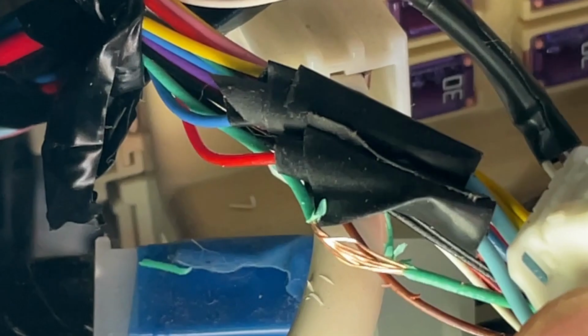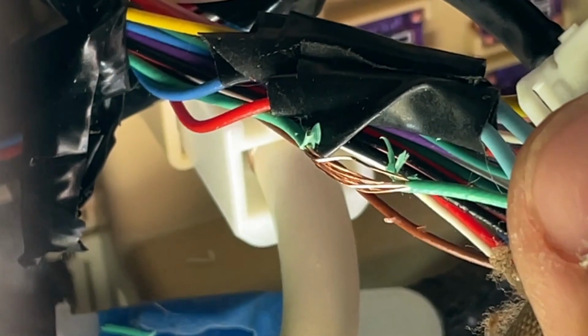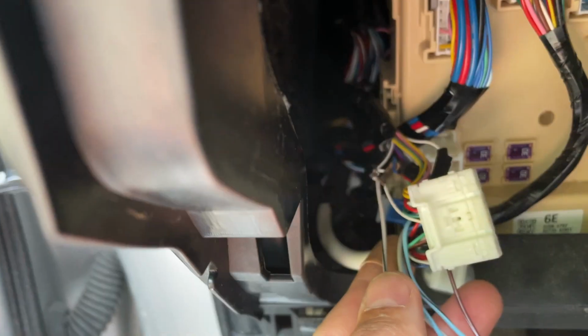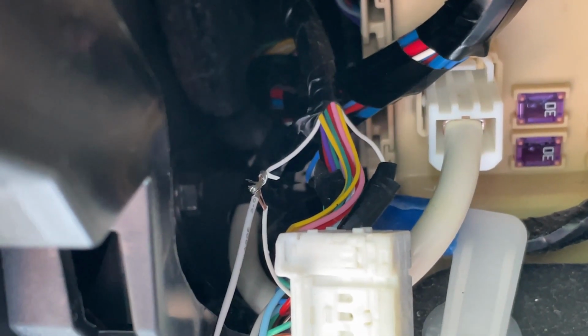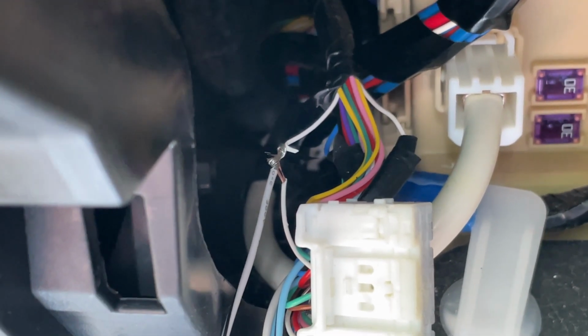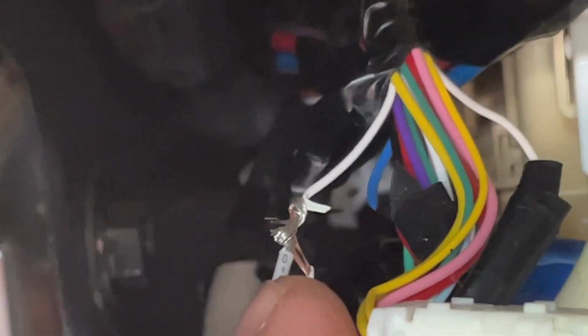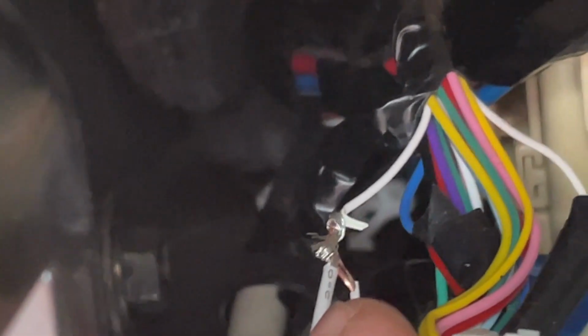All right, there's a wire I've got split open. I'm gonna thread a new wire through. All right, this is a real study in patience, I'll tell ya. It took me like a half hour to do five or six wires here. Whew. So many things are at play too. You don't wanna cut the housing or the wire covering too much, or else you'll cut the wire on the inside. And then once you get it open, you don't wanna cut the wires when you're opening it up. So you gotta let the pressure off a little bit. Yeah, there's a lot going on here. I'm glad this part's done.